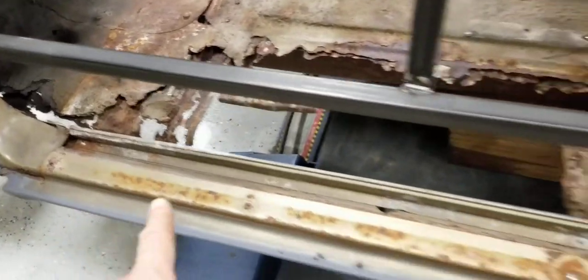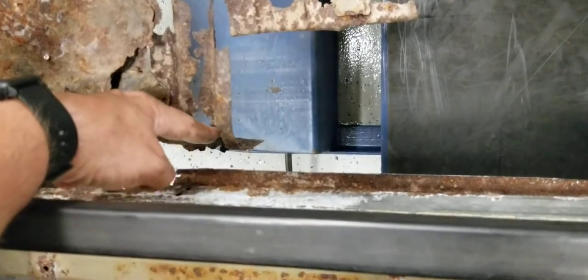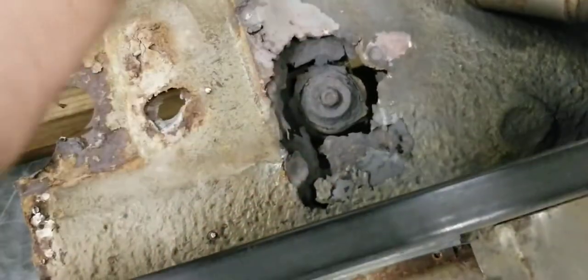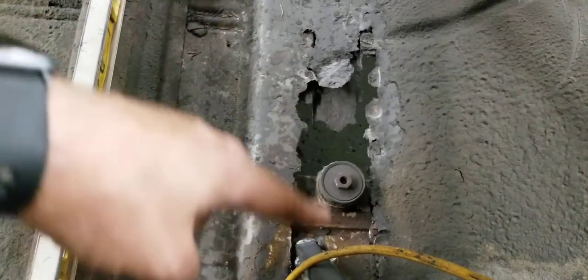Definitely a first one for me like this that's this far gone. Luckily I've got a good friend of mine that can help me through this. We're going to go ahead tomorrow and attack the driver's rocker, inner and outer — try to get some decent rockers on this thing so we can proceed with the floors and the bracing underneath. You can see the brace here that goes to the inner rocker right to the floor through the floor is all completely gone. And back here as well, the brace that goes all the way through this body mount is bad. Then there's a brace that goes all the way along these two body mounts right to the center of the car — that's got to be replaced too.